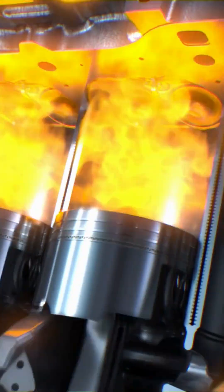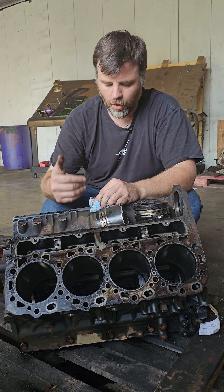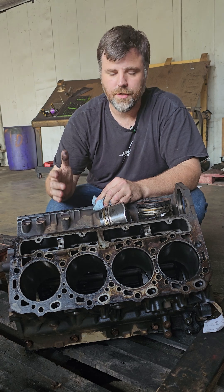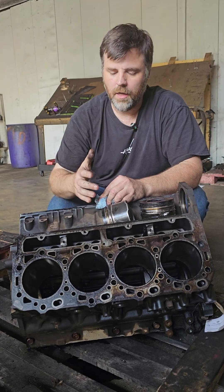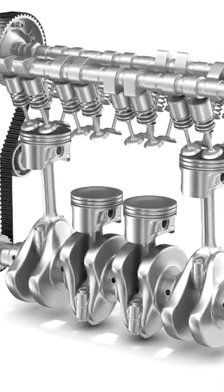What causes this kind of failure? Overheating conditions — clogged piston cooling jets sometimes can cause this, running dirty oil, and sometimes a coolant condition, because coolant pumps, thermostats, anything of that nature can all cause these types of failures. So if you want to keep your engine running healthy, make sure these things are optimal. Clogged radiators and fan clutches working correctly are all necessary to make sure your engine is going to maintain its health.